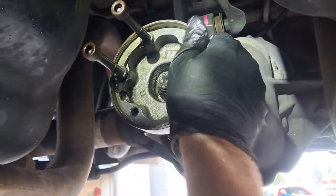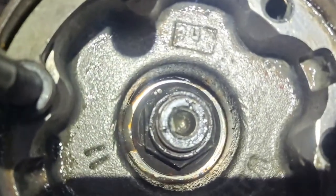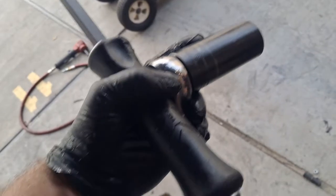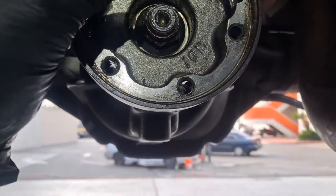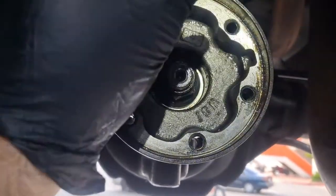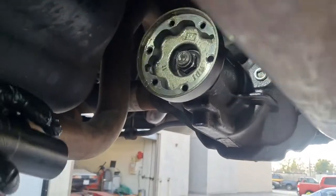I'm looking, and yeah, right there. Let me take that for a second. So you can see, maybe, the line. I went just a hair further than the line. So I think this is gonna be good. What we're gonna do now, we're gonna change this torque wrench back over to the small inch pound torque wrench. We're gonna measure our total preload. And then what I'm having Dirk do is confirm that this companion flange is maybe 55 foot pounds or so, which is pretty low, but we'll see. It's also a lock nut. Okay, please hold. Nope. Yep.